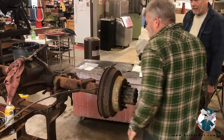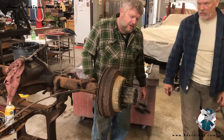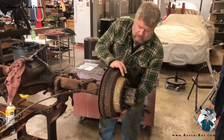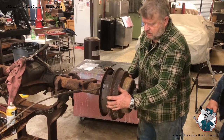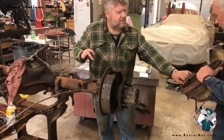We got one side of this brake drum off and the backing plate, so now we're going to pull this side off. Having learned what to do on the other one, we removed two little screws here and this old drum just jumps right off. Yeah, that one doesn't have that ridge — it hasn't been turned.